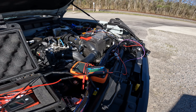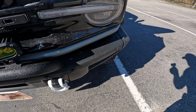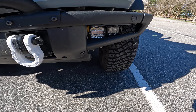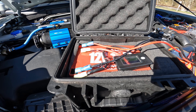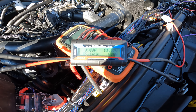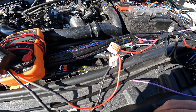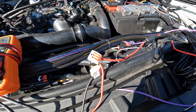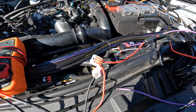So I did a little test to see exactly what happens when you use a manufacturer's harness. I'm going to show you what the amperage load is on this particular light. I've got my battery over here — this is a Dakota Lithium 18 amp hour — and you can see on the meter that it's reading 13.27 volts right now. That goes out to a couple of pigtails with quick connects I got off Amazon. They work really well for testing and have a neat little hole where you can stick your leads in to test amps and various other things.